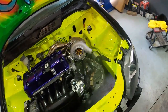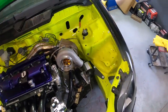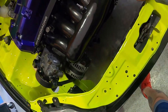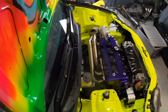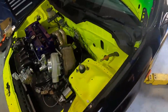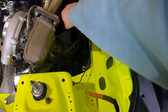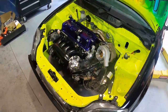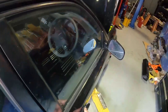I'll also need to slightly clock the turbo just a little bit up so I can shoot a pipe straight down there and join it up with the intercooler. The other side I'm going to run around through that gap and then do some fancy elbows. I'll probably take it to Andy at Elusive and get him to make me an exhaust just like the one on Gary's car — a nice 90-degree bend and straight down under the car using the 1320 muffler I've got.